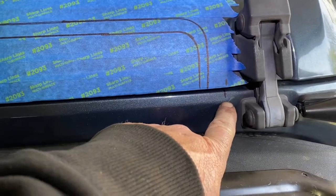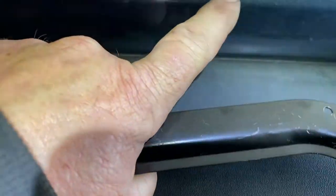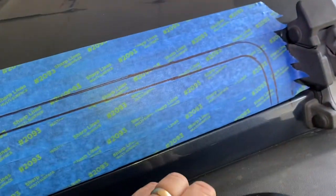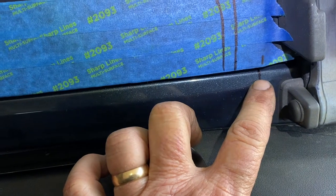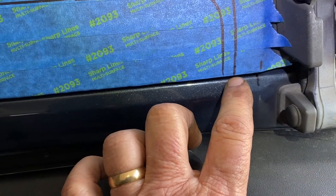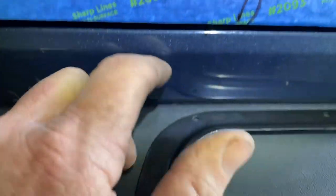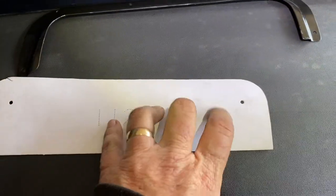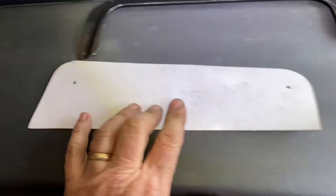I took my mark from when I had the snorkel dry fitted and lined up this flat part — it has to be flush with the bottom of the hood on both sides. Then you draw an inside mark. From the original mark you have to go in three quarters on one side and three quarters on the other. Then you can use the template they provided — pay attention that it's rounded on one side and more on an angle on the other side, so align it correctly.